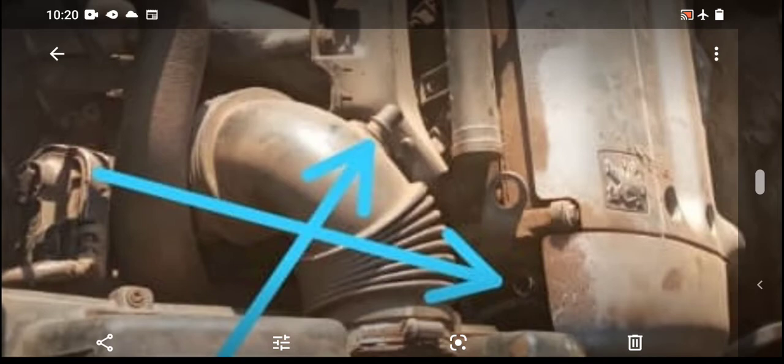So it will wear out faster because it will mess up the oil, because as the piston is moving up and down, it's actually being lubricated. It's just like pouring sand on oil and expecting it to still be sticky or lubricate. So it means that those rings, or even the pistons themselves, will no longer be protected because of that dust settling there, touching them. So as it's going up and down, it starts wearing out faster.